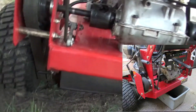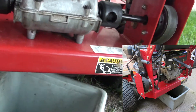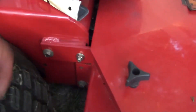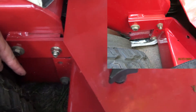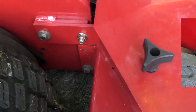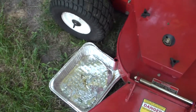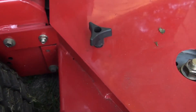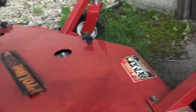A couple of things I actually do here to minimize the mess underneath: I use an oil pan and stick it right underneath there up to the flap. The second thing is a foil container that I put right underneath here — it's kind of a tight fit. You may have to lift the mower up a bit. You want to put this little foil container right in front of the flap so if any oil gets to the front of the flap, it's going to drip right into the foil pan.